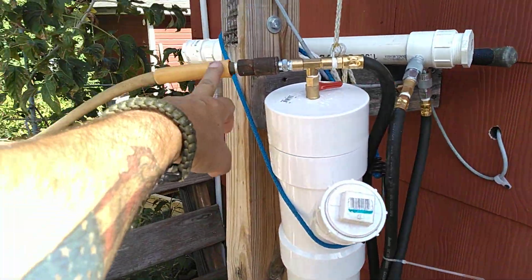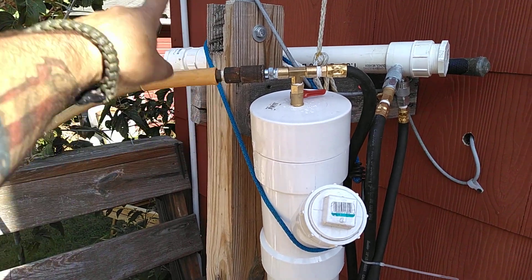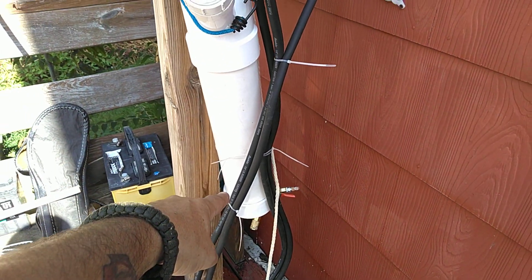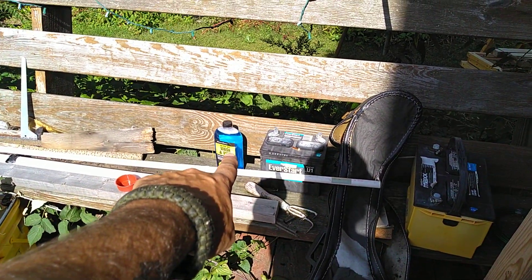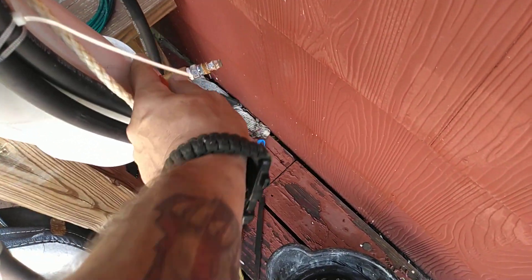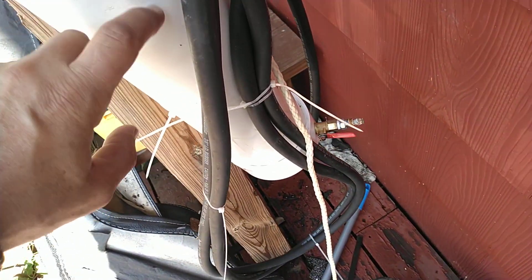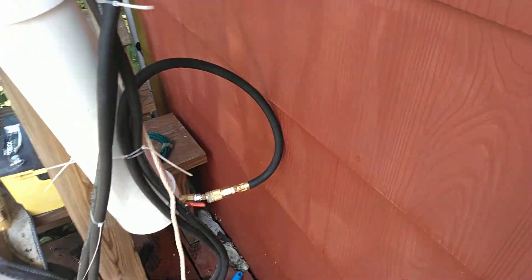What we have is about two bar, which is roughly 30 PSI — 29 PSI — air pressure coming in here from a compressor that's in my garage. If I open this valve, it will charge this tank up with 20 PSI of air. Inside this tank there's a soapy solution — I'm going to try this car wash soap, it's supposed to be super foamy. A couple ounces of that into a little over a gallon of water, gallon and a half, fills that tank up. This valve is normally closed, but when I do open it, the pressure in here pushes that fluid out into this quick disconnect, which travels all the way around.